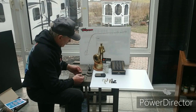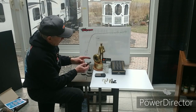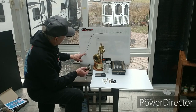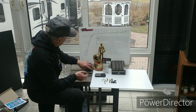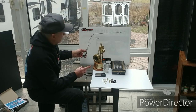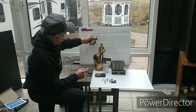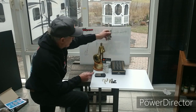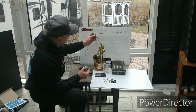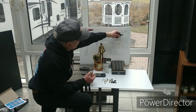Let me explain the other extreme. I put in a weight that's a little lighter on the tip than stock. Here's what happens: my engagement went up to 4,000 to 4,100, which means it's going to act like one degree less angle on my beginning number on the helix. So it would be like a dotted line — I'm going to be a little more revvy all the way until I get back into my power. Once you get back into the power, it's all about total weight, because by now your weight — like a teeter-totter with the big guy on it — is over here. So now we straight line.